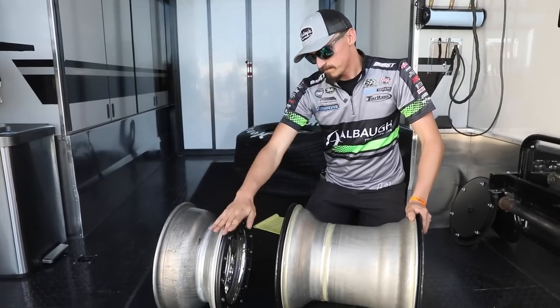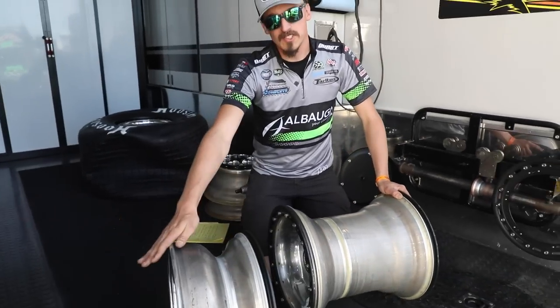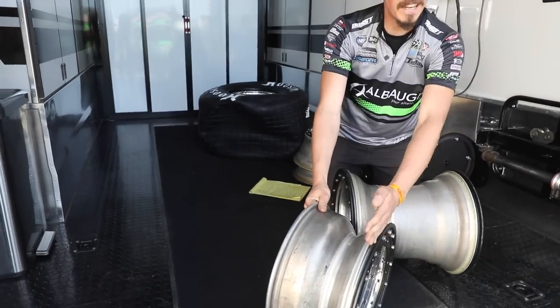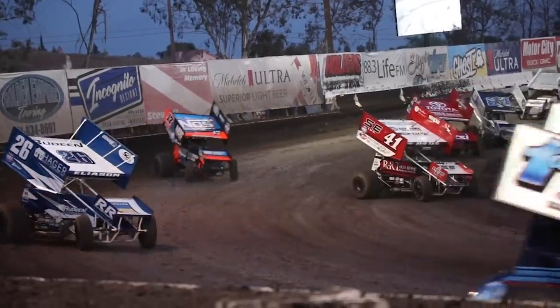You will have a bead lock on the inside of your left rear and on the outside of the right rear. Think about when the car slides through the corner — if it slides this way, you want that leading edge to have the bead lock ring so that the tire doesn't pop off the bead.